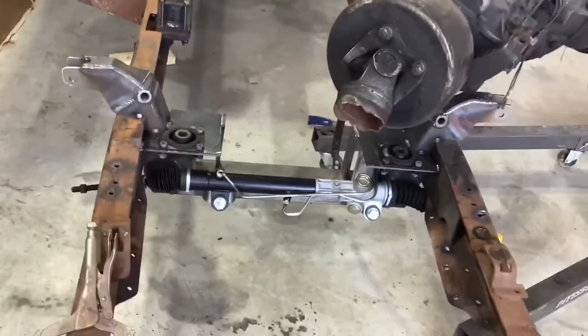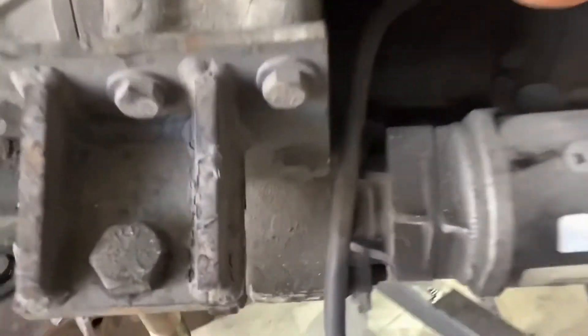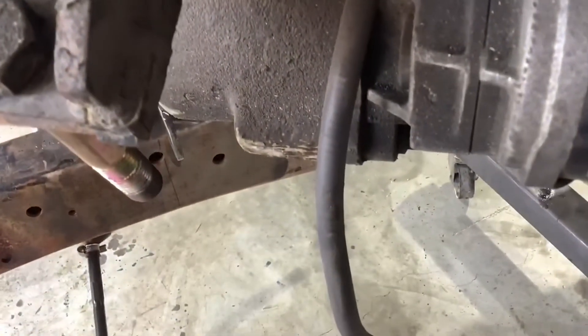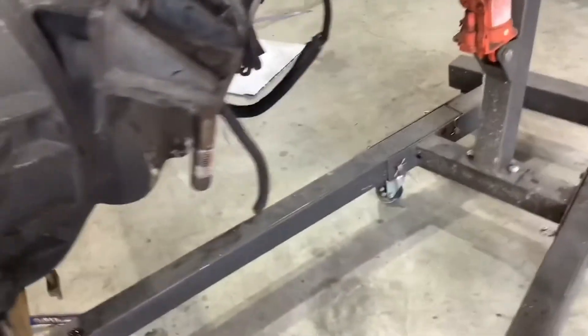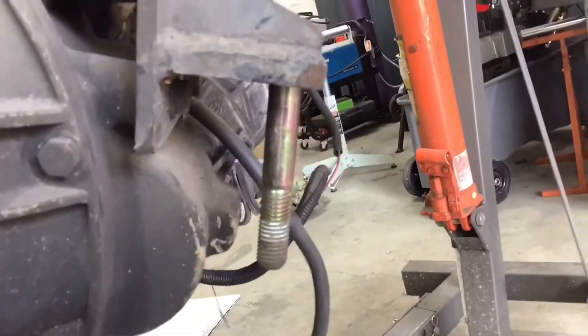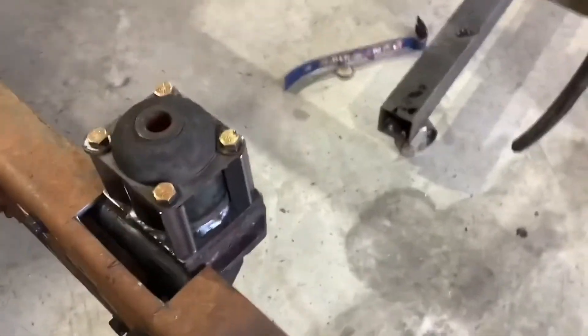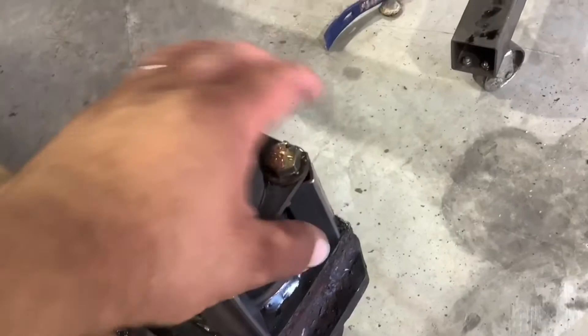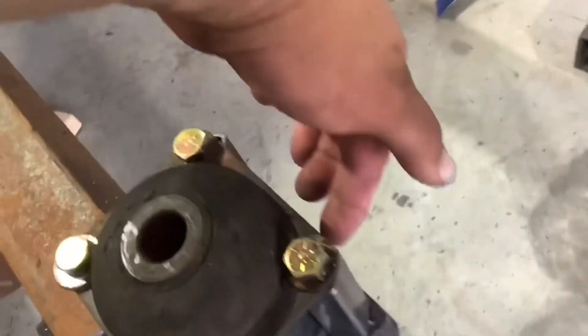Another obstacle. This starter mount right there — the starter housing, flywheel housing, all that — is hitting our extended mount. It didn't matter when the mount was real thin; it fit right underneath there. But now since we raised it, even though it's still just loose and we didn't tighten anything down, when we try to tighten it this corner here is in the way and around this side too. I'm not sure what we're going to do there, so we've got to do a little experimenting and see what it's going to take.